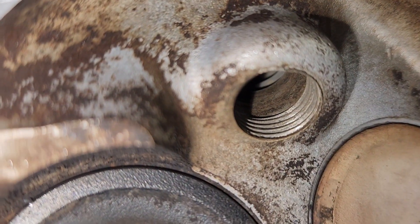That causes big problems. If you have a 5.4 or a 4.6 like this cylinder head, the real early ones only have a couple threads, and people changing spark plugs can cross-thread them easily because when there's only a couple threads and your engine has 180,000–190,000 miles and it's 15–20 years old, it's really prone for these cylinder heads to strip the threads out and even shoot the spark plugs out. They eventually changed that in the later years of production, then moved on to that crappy three-valve. The 5.4 and 4.6 actually made a really nice head in the later years, and then they just went super downhill with that three-valve.